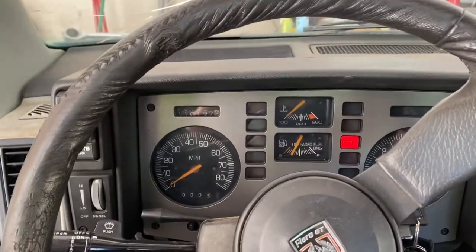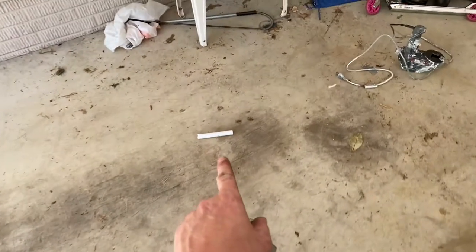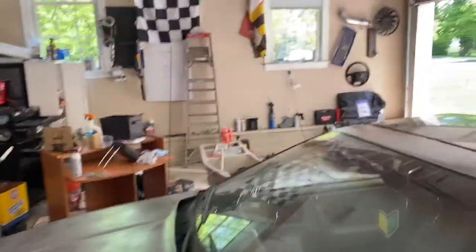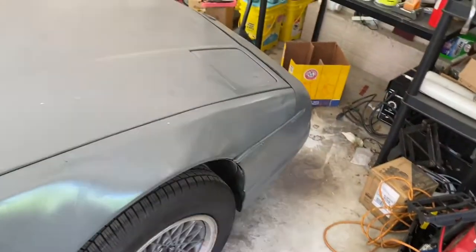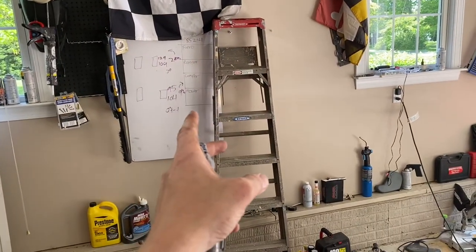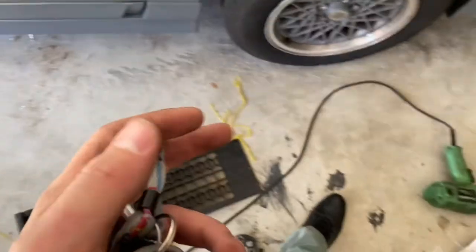Now we just got to see if it holds on a hill. I was going to show you how I did a homemade alignment, but I just moved it and it broke. Those numbers over there mean stuff — hopefully they're still good because I can't check now. Basically the front left wheel seemed like it was toeing in towards the center, and the back one was toeing out. We did 20 millimeters in the front and 9 millimeters in the back, but I have no idea how good that is because moving that stuff I broke it.